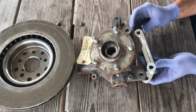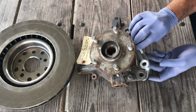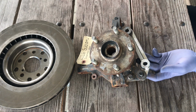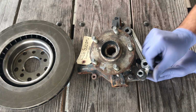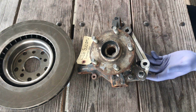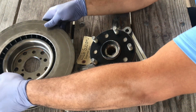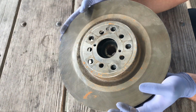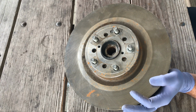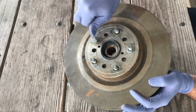Next, you want to install the BWC Fab bracket. Slide your lower bolt in. With the kit, I provided locking flange nuts, but for this video, I'm just going to use a standard nut for the install. Install your rotor spacer. Slide the rotor in place. Just using these washers and nuts just to hold the rotor.